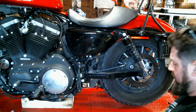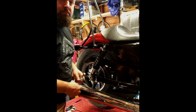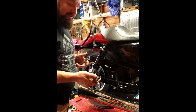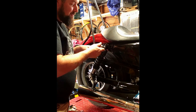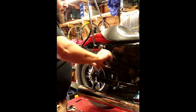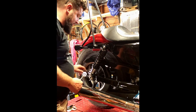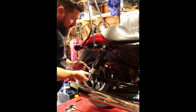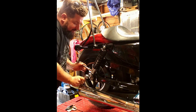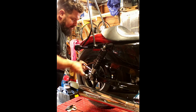We're going to pull this shock bolt out here. Let's take the top one off first. Alright, we're over here on the right side of the bike. In all fairness, I haven't even broke these bolts free yet, so you'll see about how tight they really are. Nothing crazy - anybody can really do this. Just make sure your Torx bits are seated in there really good and solid. It's easy to have them sticking too far out and they strip out the bolt. There you have the top one. Bottom one - just get your wrench back on the back side of there. There's not a whole lot of clearance.